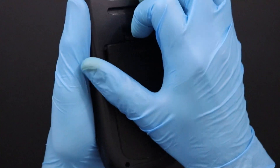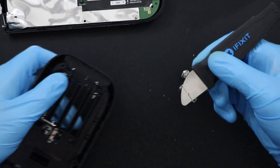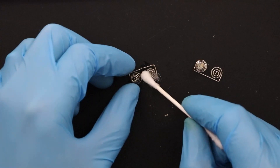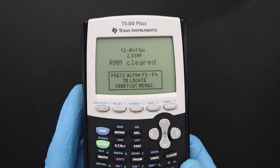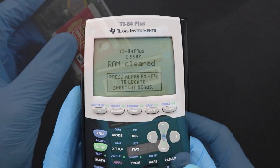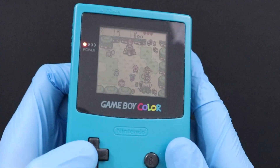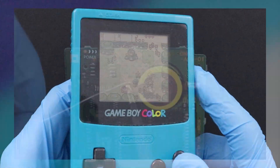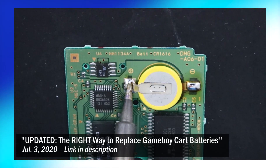As I briefly mentioned in the beginning of this video, you can use this method for cleaning alkaline battery leakage on all kinds of electronics. For example, I cleaned this TI-84 calculator that also had that problem. The process was pretty much the same, separating plastics from metals and cleaning with vinegar and IPA. As for the Zelda cartridge, it eventually did get fully restored, and I cleaned all of the gunk and dirt off of it. I also installed a new save battery in it, which I show how to do in another tutorial video — I've put a link to that tutorial in the description below.